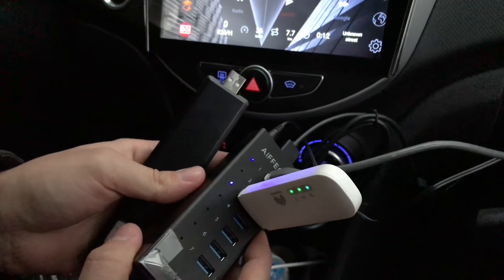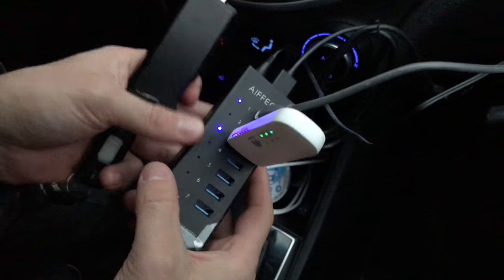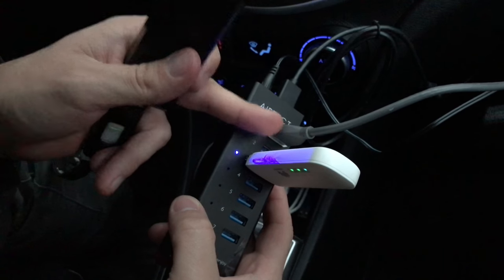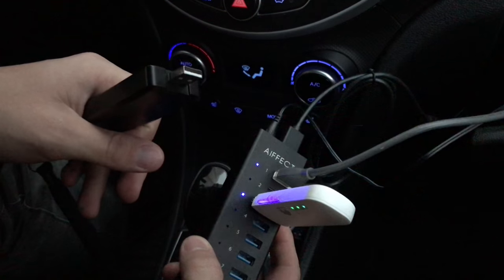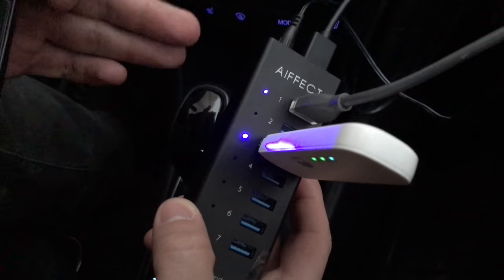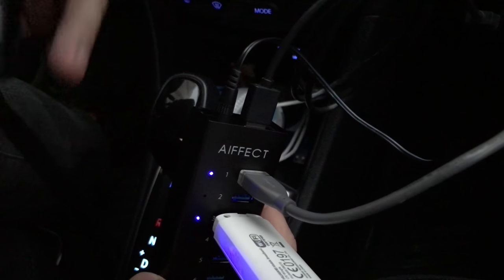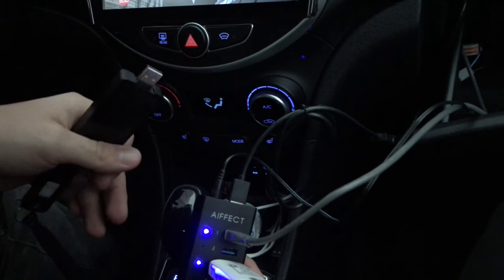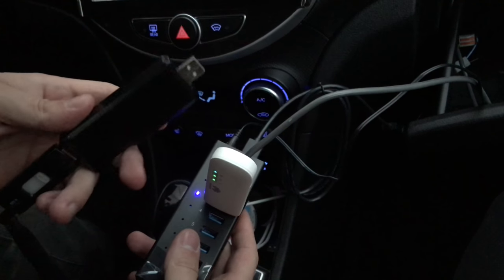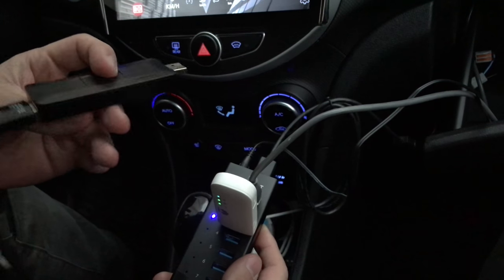Next is the USB hub. I went and purchased a powered USB hub — I found one on AliExpress, just any one that wasn't too expensive. This one happens to have seven ports and be USB 3.0, but that's not necessary. I have a USB DVR for my dash cam and a USB modem slash Wi-Fi stick. The main thing is cars are 12 volt, so I wired up a 12 volt power supply to the active power here, to the accessory wires — make sure it only turns on when you turn on accessory power. Because this thing needs a lot of amps, more than the standard 0.5 amps; each port should be good for two amps.